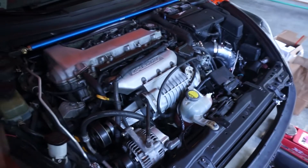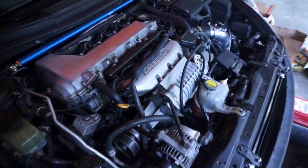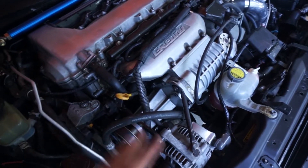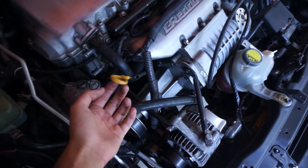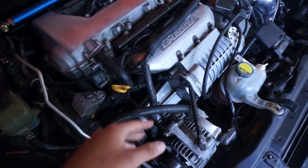For everyone new to my channel, this is my 2ZZ, it is supercharged. But if you guys don't have a supercharged 2ZZ, everything is gonna look pretty similar in the video — underneath is the same exact side. We're gonna start here with the dipstick. If you guys don't know how to read your oil, you're gonna take it out, wipe it off, put it back in. If it looks sludgy, dark, or thick, it's time to change your oil.